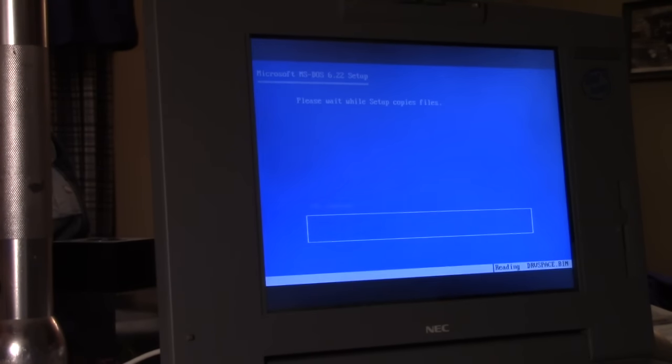Now, SSDs obviously don't have any moving parts, so it's not even an issue anymore. So what I was talking about is on the MacBook Pros, at least I can only speak for the 2011, 2012, 2013 models. If you were to install a hard drive that had its own accelerometer, as I did on my 2010 MacBook Pro, 2009, what happens is the drive's accelerometer and the motherboard's accelerometer conflict with each other, and that drive parking feature doesn't work correctly anymore. So you actually have to run a Unix command that disables the onboard accelerometer, and then it just works off of the hard drive's built-in accelerometer.